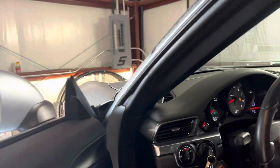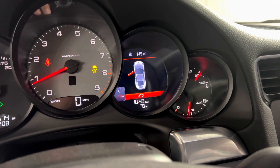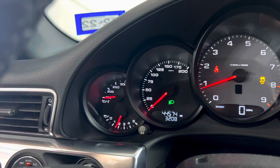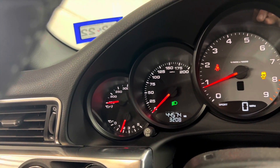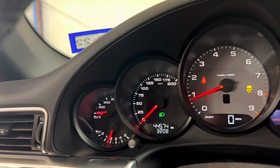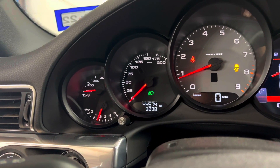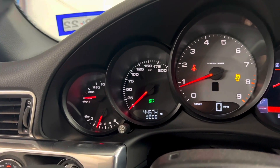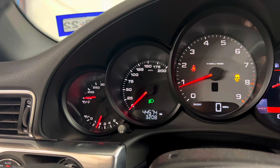Let me take over the camera for a second and tell you guys what I mean when temperature matters. Right now we have about operational temperature on the cooling, but take a look at that — the oil is not even at 150 degrees just yet. That right there is really important before you start ripping this thing all the way up to 7,500 RPM. Cooling is already up there, so there's definitely some temperature on the engine. I want to see somewhere in the 175, maybe just under 200, right before we start doing pulls.